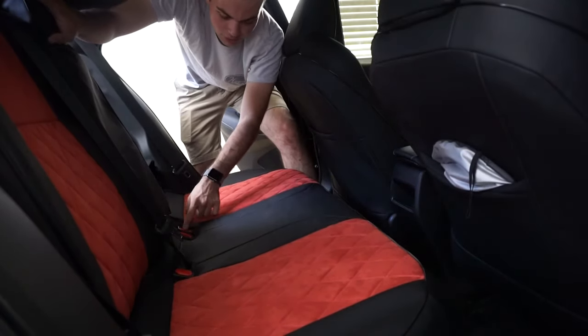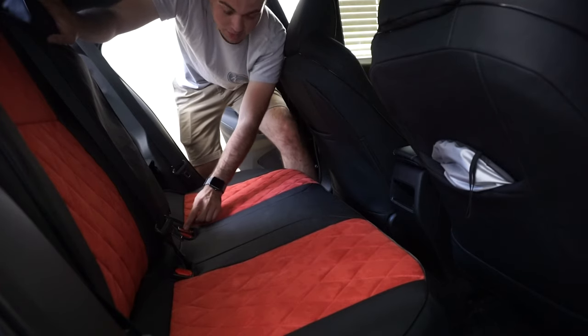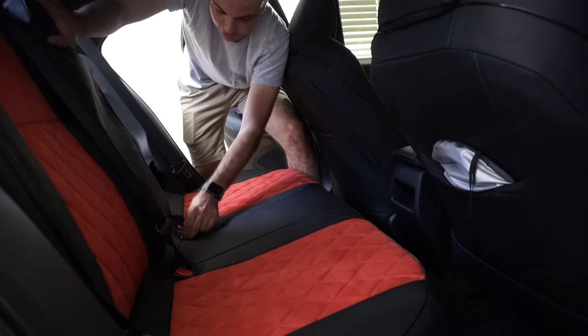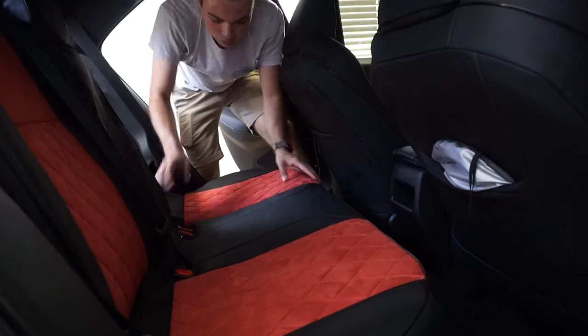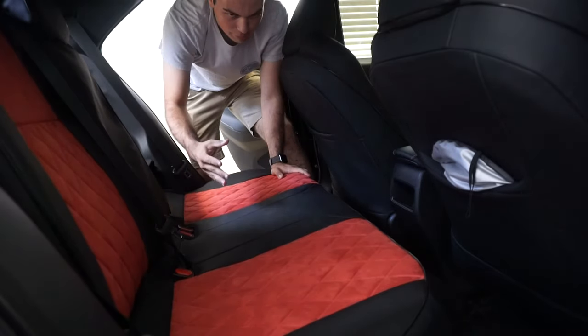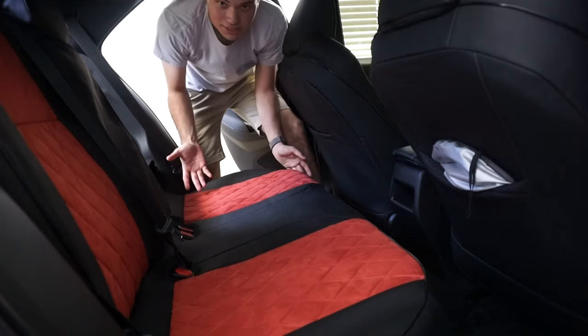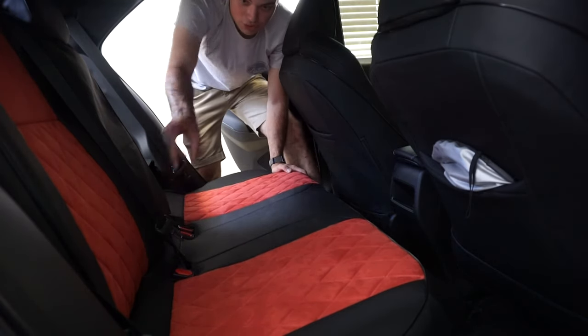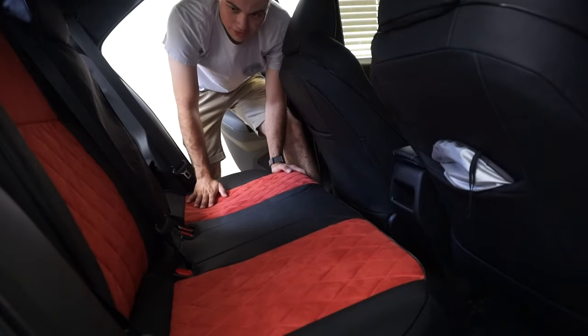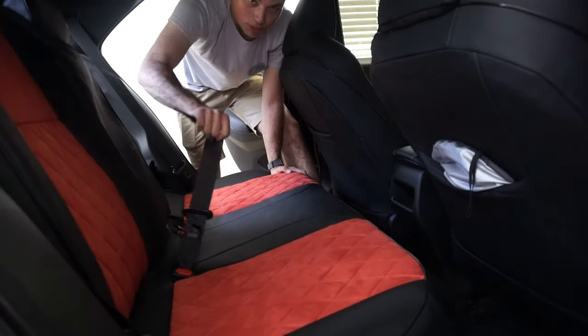Make sure to be careful of these clips because they're going to attach to the harness right here. So when you pull it off, pull it off slowly — make sure you don't rip them out. And that's pretty much how you take out your back seats: two 14s this side, two 14s there, pull it out. And when it comes to the seat belts, there's going to be one more clip.